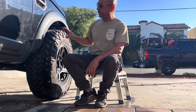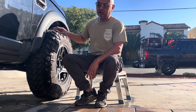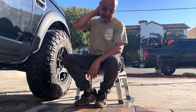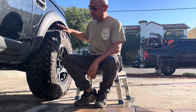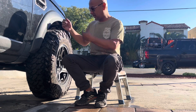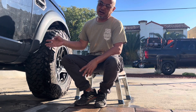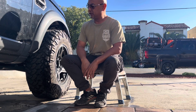If you're adding bigger tires or doing any modifications to your vehicle, you might want to adjust this area. As I've mentioned in a lot of my other videos, I actually take off the wheel well liner — the fender liner — just because I'm doing a lot of suspension work in the back here, constantly fixing things, and it's always a pain to navigate around it. You have to take off all the panel clips and pull that thing out, and it's big and cumbersome. I just tend not to run them at all, which will make this mod a lot easier. You are going to have to remove the fender liner to be able to get to these panel clips.